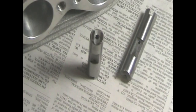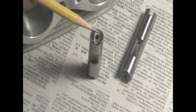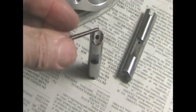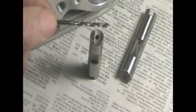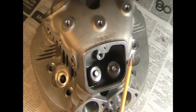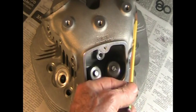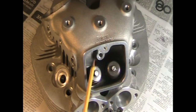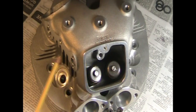Before you install the rocker arms, you can clean things up a little bit and get rid of one overhead oil line by drilling through both intake rocker arm spindles. You can see where I've ground through the surface hardening. Then I use an eighth inch diameter carbide bit and drill it about an eighth inch deep. After that, you can drill it all the way through with a cobalt bit. Now the oil can feed up through one oil line, pass through to the exhaust, pass through one intake rocker spindle through the center, and then through the other intake rocker spindle and through to the exhaust.